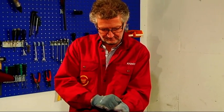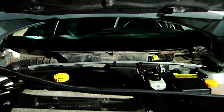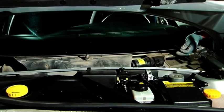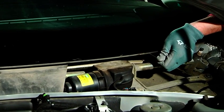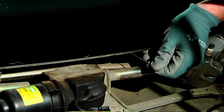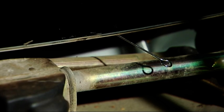Wipe off the glass and the suction cups in order to make sure they're dry and clean. Check if there are rivets or other obstacles under the downside of the glass where the cutting wire risks getting stuck. Use steering needles to lead the wire right. Stick them into the adhesive bead.